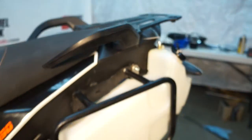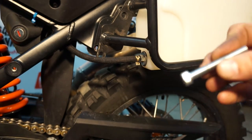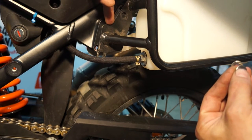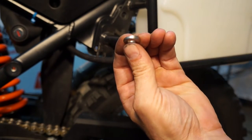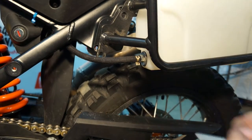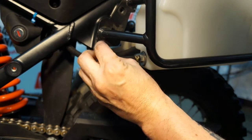We'll leave that one loose and come to the front. We have the full-thread bolt here because the 1190 has the subframe pad on an angle, but the bolts go straight in. They've given you an angle-cut, slash-cut spacer that goes on. We're going to take this longer bolt with that spacer — you'll want to put Loctite on this bolt.